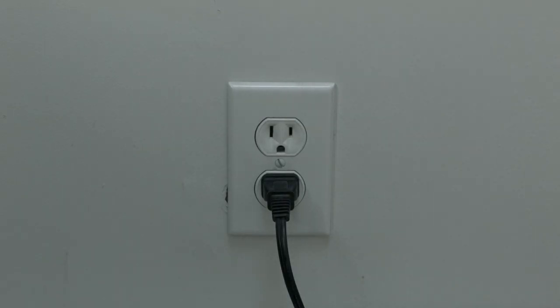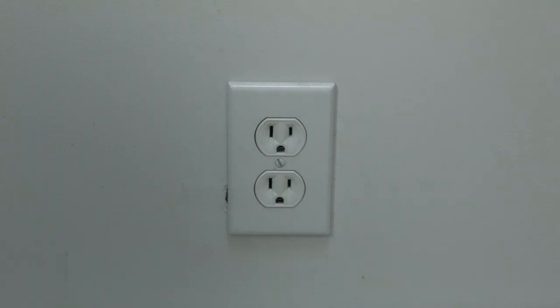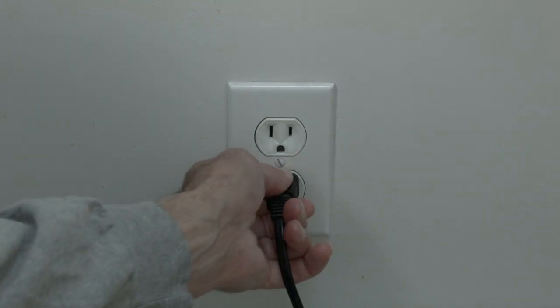You should probably try the soft reset first if possible. If that does not work, we'll go on with the hard reset — the factory reset — and that should take care of your problem. The soft reset is real easy to do. All you need to do is unplug the TV from the wall — don't turn it off by the remote, unplug it from the wall — wait about 60 seconds, and then plug it back in. In most cases this will solve a lot of your problems.